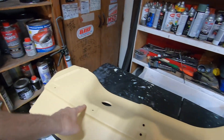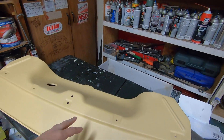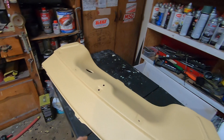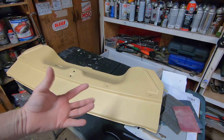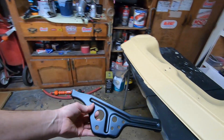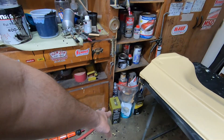Moving to the splash apron — I've welded square nuts in here so I can use 12-point ARPs. I did the whole front clip with square nuts welded in to get rid of those ugly factory coarse-style bolts. There's a bracket from the factory that's riveted on underneath; you can use 10-24 button-head allens there as well. I drilled speed holes in that bracket too and wiped it with filler and blocked it out so it's very slick. The beauty is this bracket is a separate piece, so I can put raptor liner on it separately — it creates a nice breakup of black under there.